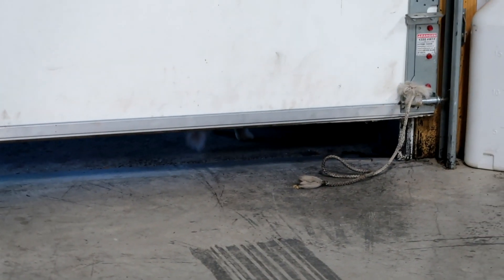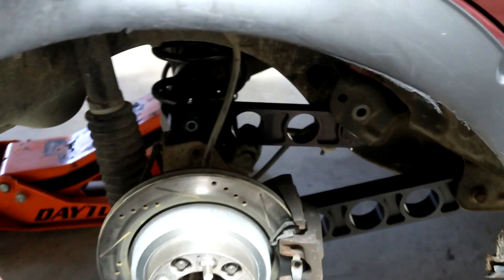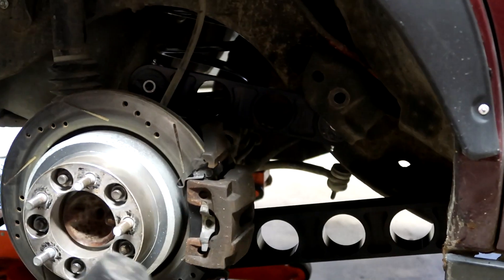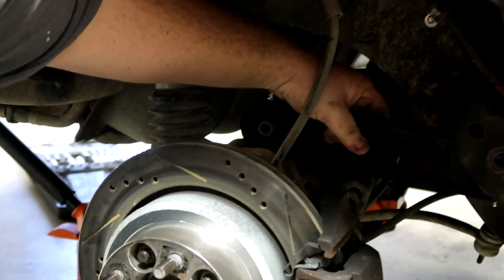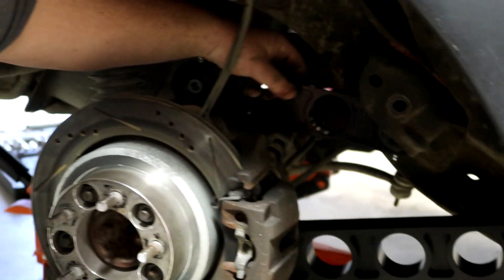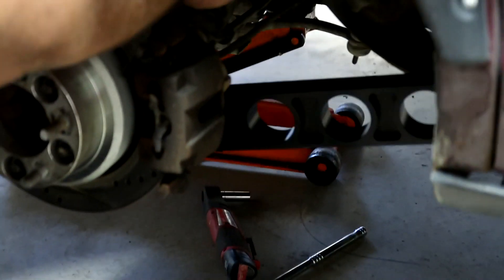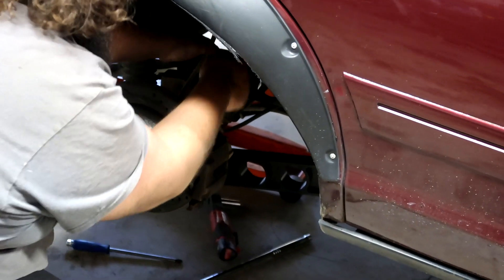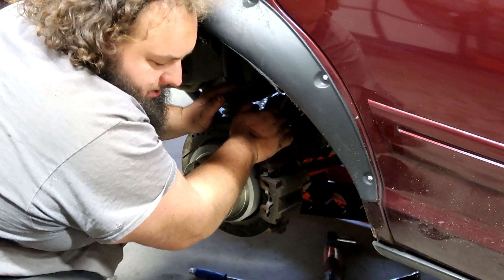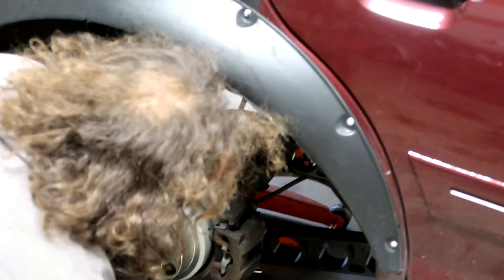All right, so this is the last arm Will's got to install on this thing. It's been a fairly straightforward install — really straightforward. We ain't had no snags, no hiccups yet. The bushing's a little tight on the axle side, you just got to tap it down into place, but other than that it's been pretty straightforward. We already filmed the other side, so it's a direct copy. He's going to go ahead and button this side up, we'll tighten everything down, get this thing back on the ground. Are we taking it out? Yeah, we'll take it up the road — see if we feel a noticeable difference. Maybe add a little more rubber to the inner fenders, but we'll wait.